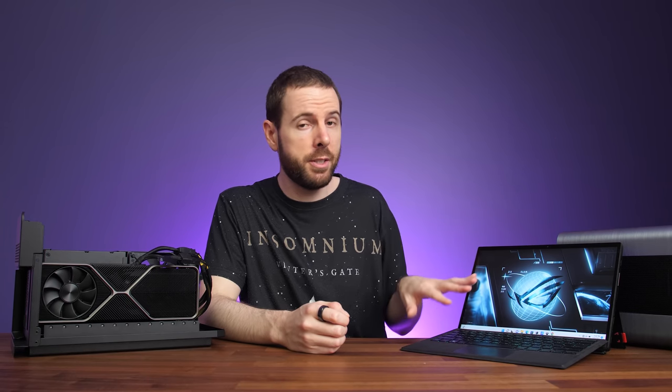Here are the 3 major problems that I had while testing a Thunderbolt eGPU with the Z13. The first major problem was that anytime I connected my Mantis Saturn Pro 2 eGPU enclosure, the Z13 would blue screen within about a minute, then just sit in a boot loop until I unplugged the enclosure. I was able to work around this by using DDU to uninstall the Nvidia drivers, then connect the enclosure and reinstall the Nvidia drivers, but that's not exactly something practical you'd want to do every time you connect your eGPU.